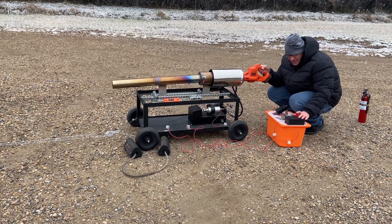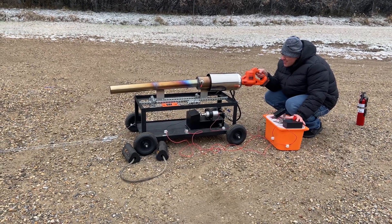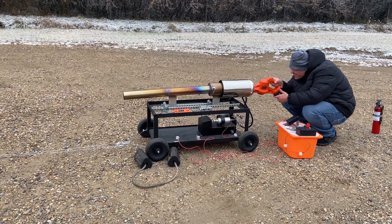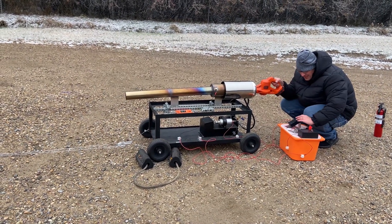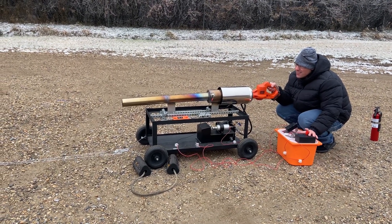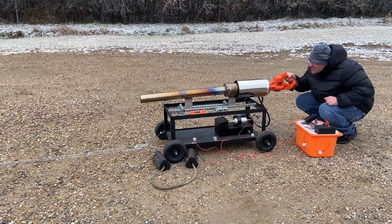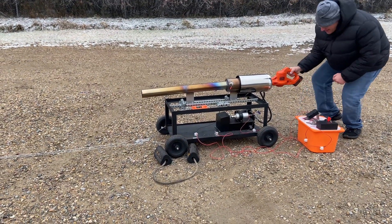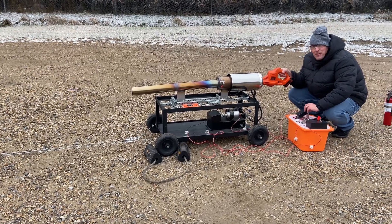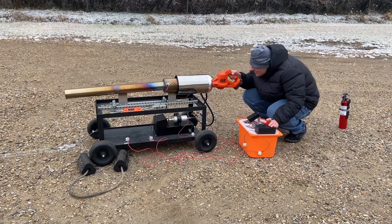Usually it's about 75 PSI, and if it's not 75 PSI, these engines are very sensitive to anything — any pressure problems, any fuel-air mixture. And if there's no shockwave, it's not going to run. I use my leaf blower to start it, I put the ignition on and then the fuel pump on, and if I don't get that initial shockwave to start that engine, I have to redo everything again. And hopefully I get that balance of everything.